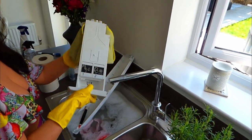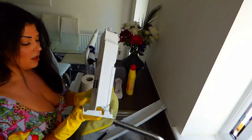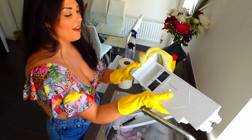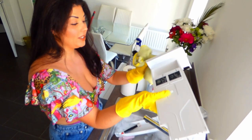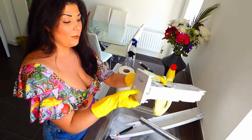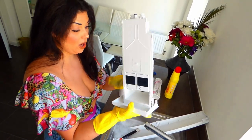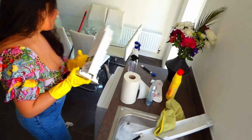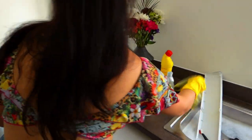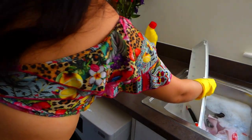We can now go ahead and put our attachments back on to the machine — just make sure that they're dry. These have obviously just come out of their bleach water. This is a high-traffic area of the dispenser drawer because people will be opening and closing it daily to put in detergent or fabric softener, so it's really important that you soak these in some sort of disinfectant, ideally bleach at this moment in time. And then that can go back into its little home, and we'll clip the base back on.